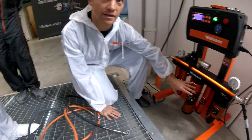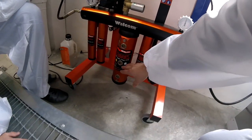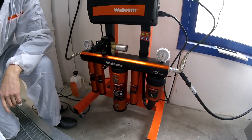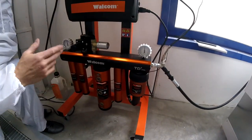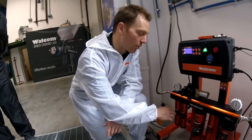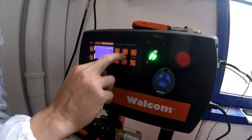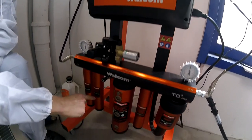Silica is very effective but needs to be maintained, and this unit is self-maintenance. As soon as it absorbs humidity it will turn blue — once they're saturated with humidity they'll turn blue. At that point you are supposed to bake the silica to restore it back to normal condition. Here we have a very simple system: a bulb which we switch on, the heat goes back into the silica, it completely dries, and the moisture is discharged. Then you are good to go in perfect condition again.